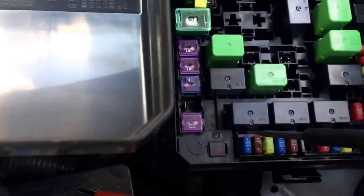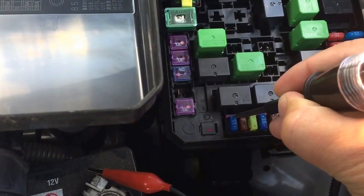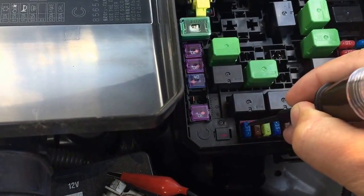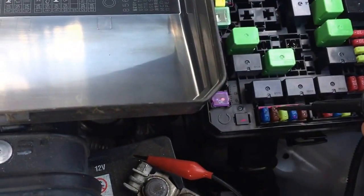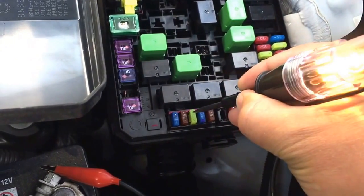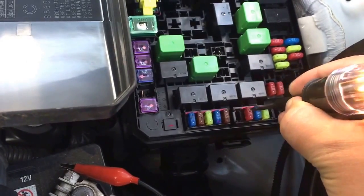For this instance, how to do it is you touch one end of the fuse. If it lights up and the other end lights up, that means the circuit from here to here is good — it's getting juice all around. So we're getting power on both ends.